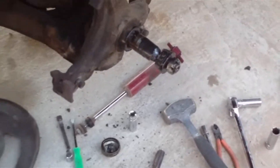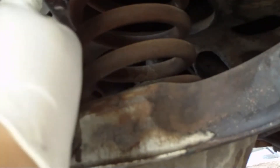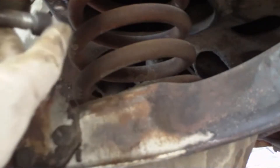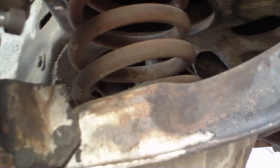Now it's time to move on to the other side. Just getting the caliper bolts out now — that's the first step to this. Now that I got that free enough to slide in and out, I got to do my top bolts.